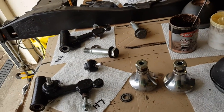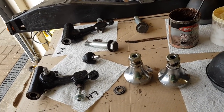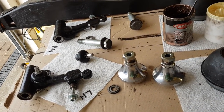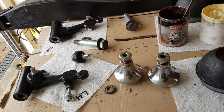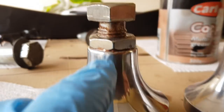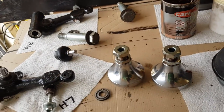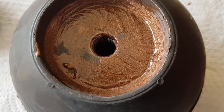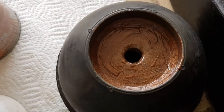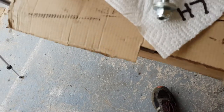When you're ready to put everything back together, you'll be tempted to jump into the car and start putting parts in place and bolting up - which is what I did the first time. But if you prepare everything on the bench first it'll make your life so much easier. For example, the hi-los are all copper greased up through the threads, cones copper greased - just keeping it clear of the rubber because it's bad for rubber. Same on both sides.